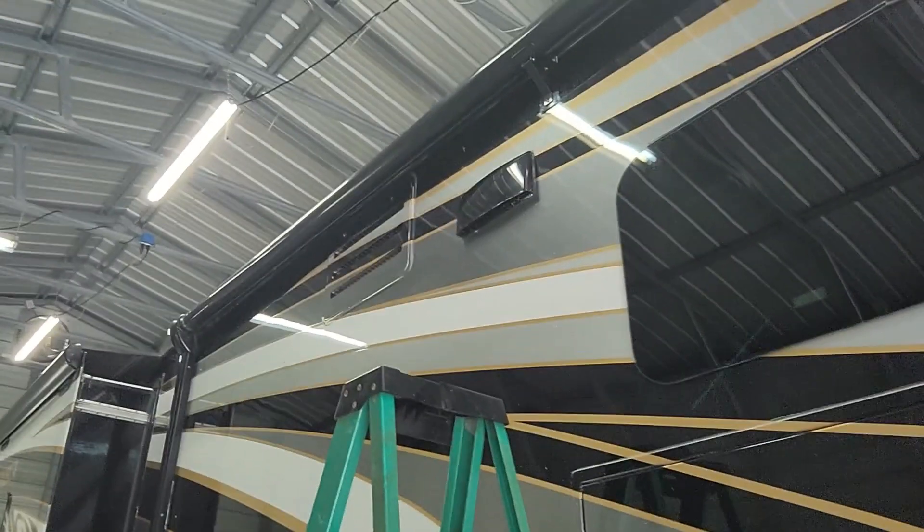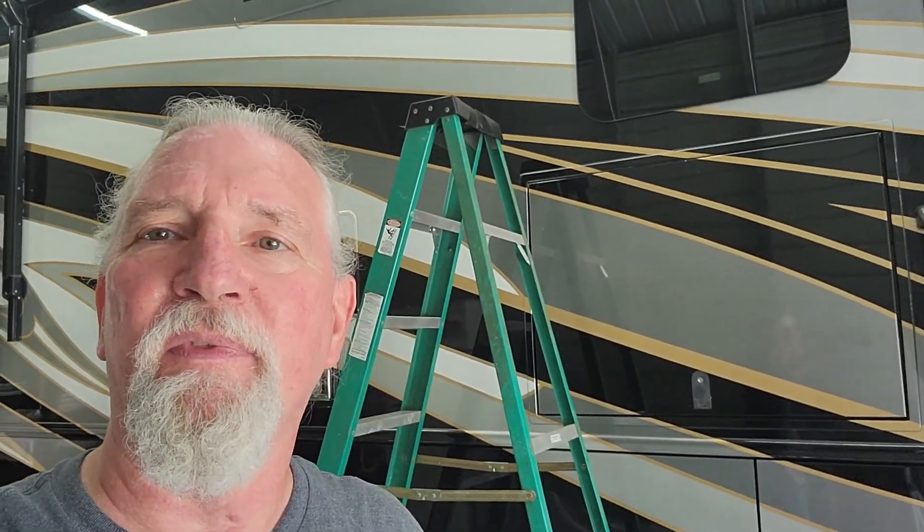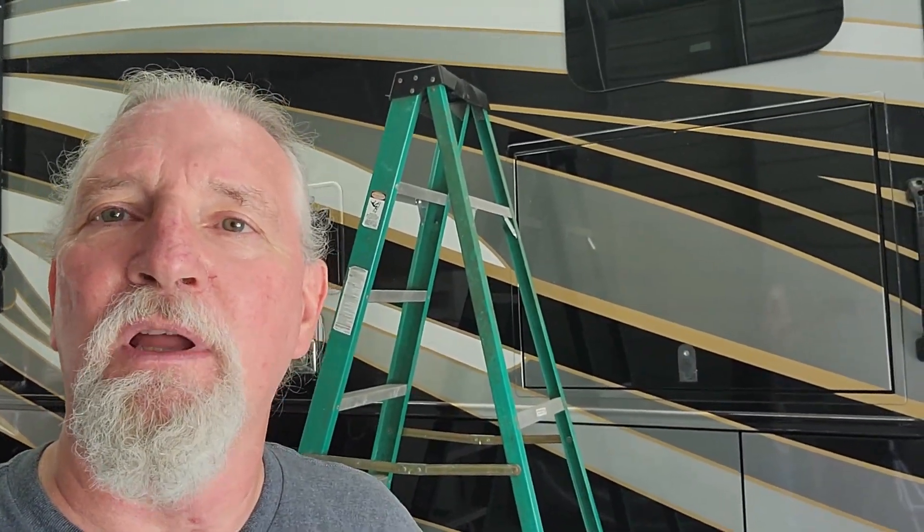All right, there's the project done. Can't really see it, which is a good thing because it's black on black. That's something that's been bugging me ever since the Super C rally. Shout out to those of you who know him on the forums as Rusty Nuts, or at the rally and on the Facebook pages as Brian — I didn't know you needed to put a support on this length of awning until I saw his. Thanks for the idea. It was a pretty easy project — drilled some holes, filled them with some goo, and mounted the plate. I was hoping to find the stud and use just two screws, but I ended up using the plate with a total of six screws into the side of the RV. I think I got them all sealed pretty well. The awning will hopefully no longer bounce as we're going down the road. Hope you learned something — if you need part numbers, I'll try to put them in the description below.